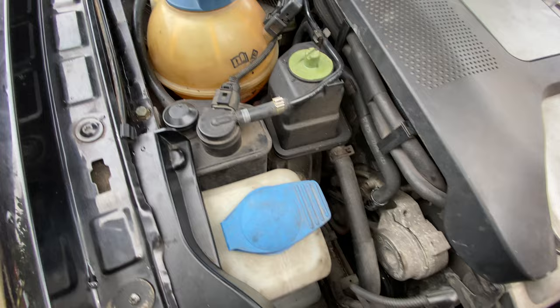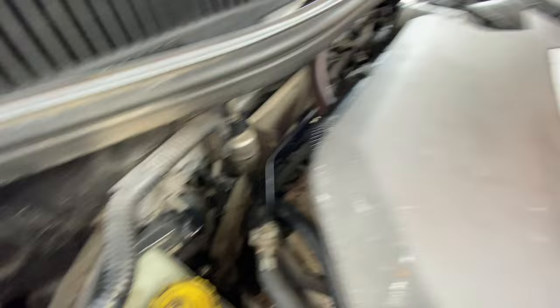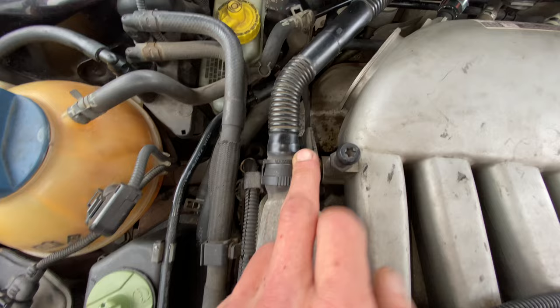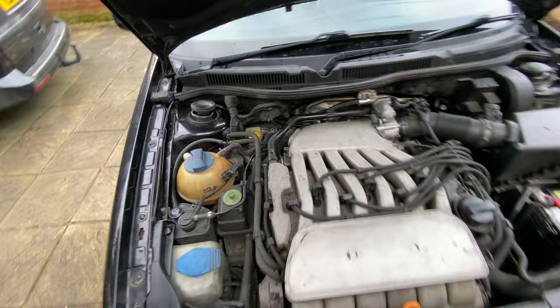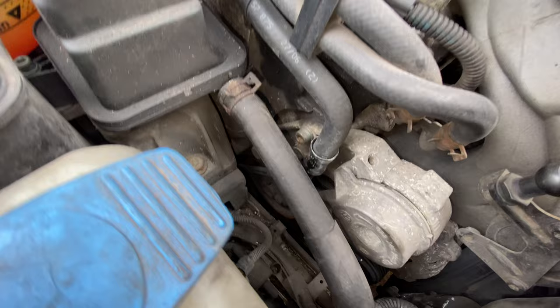So the only other way is to raise the engine up. There is an engine lifting mount down here. Let's take this cover off — it was only just sat on there to make it look good, but I actually need to get some of these little rubber clips. I can take this off, that goes to the PCV valve, and directly below it is a hooking eye so I can use that hooking eye.